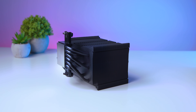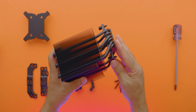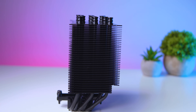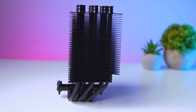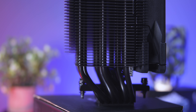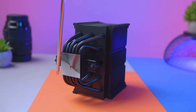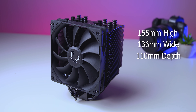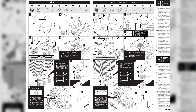Another hallmark of Scythe's design is their asymmetrical layout for the entire Mugen lineup. This one has six 6mm heat pipes that are swept a little bit forward, so the entire thing looks a bit hunchback when viewed from the side. This brings the fan forward so it's right over the mounting bracket and not slamming into your memory modules. There's also an indent on the other side to make sure the fin array can clear RAM on quad-channel Intel HEDT systems. The base finishing is damn near perfect and slightly convex. All this leads to a heatsink that's shorter than the Noctua U12S at just under 155mm in height and a bit wider at 136mm.